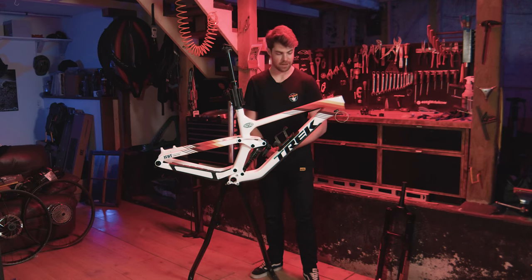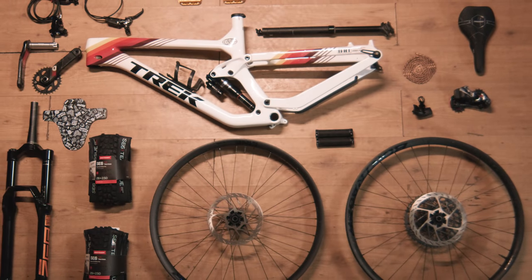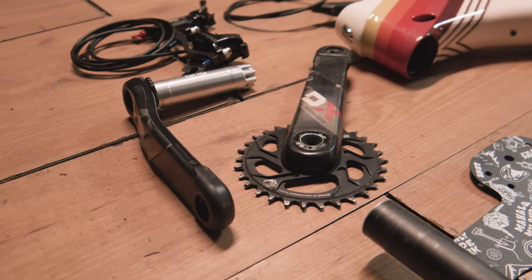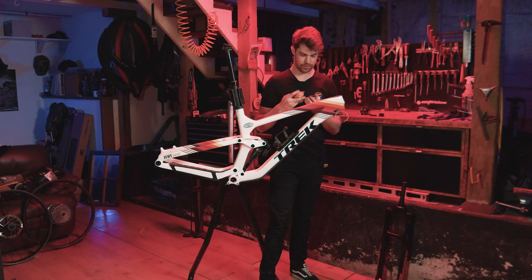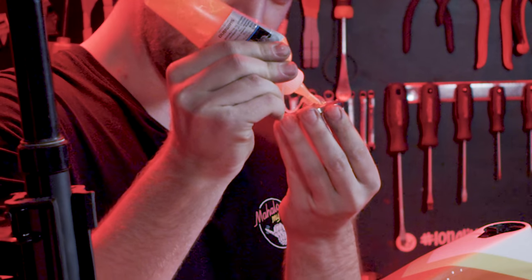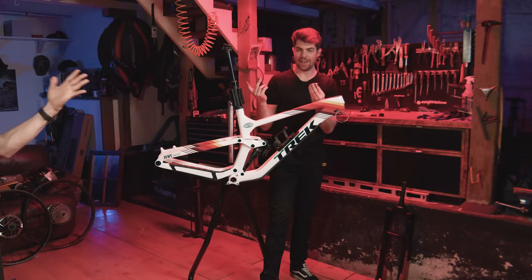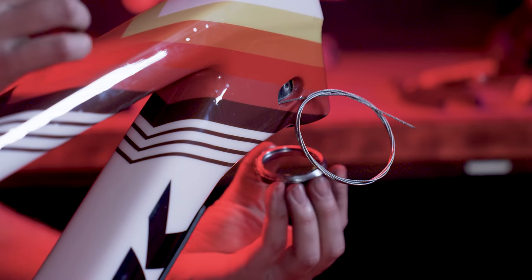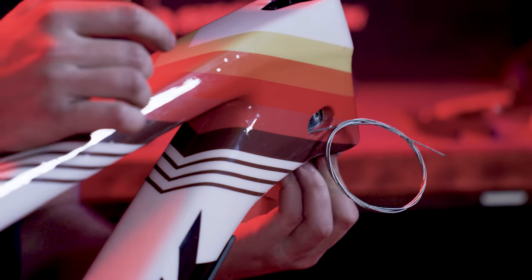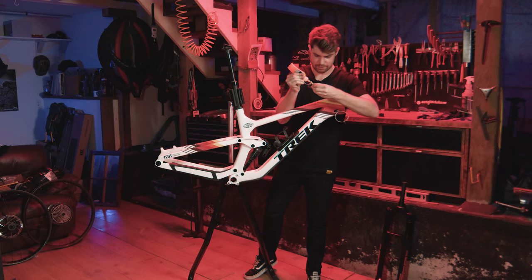A lot of the parts on this bike are from the bike already, so that's quite nice — I don't have to cut any steer tubes. But there are also some new parts going on. We are going to start with headset bearings, re-grease them — you guys know how much I love grease. Nice thing about these frames: the bearings just go right in, and with the grease they will stick. Really just easing into the build here.